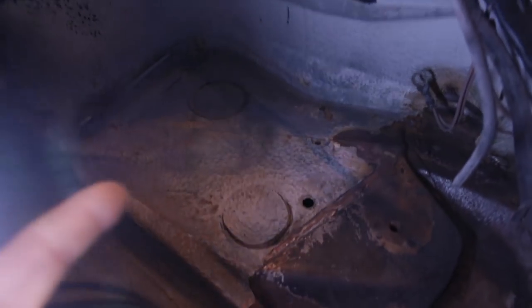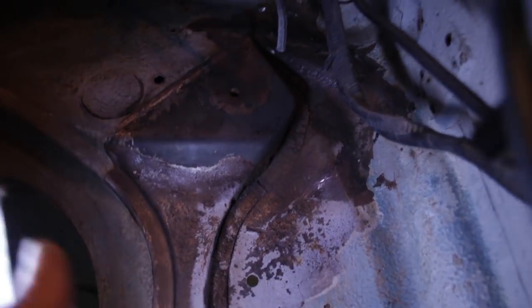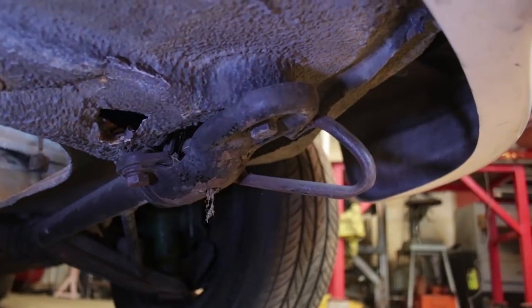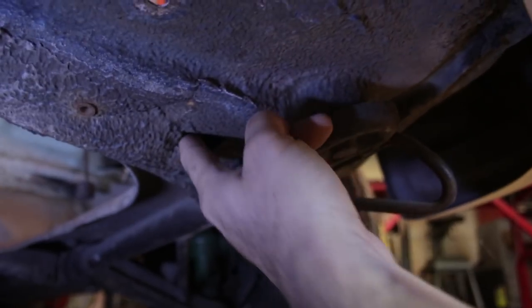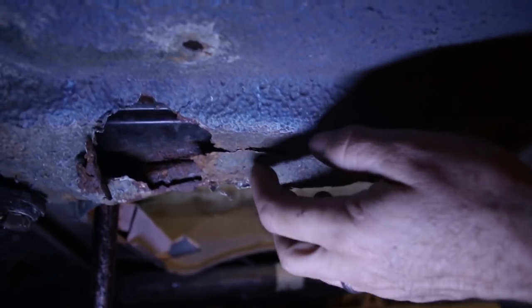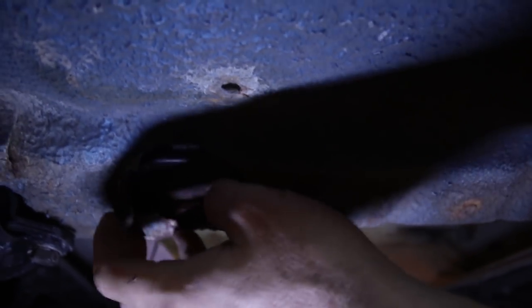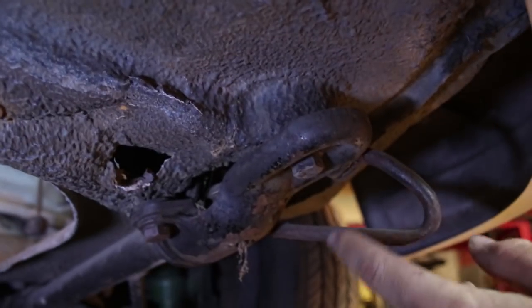At first glance it doesn't look that bad from the inside. This is the battery tray — this area right here is where the battery goes. Once the battery leaks, it all seeps into these low points in the seams and then goes underneath. Here's what it looks like from the bottom. Looking at the driver's side, just underneath the battery, there are huge holes. The corrosion can travel all the way down to the passenger side. This is where the suspension arms attach, so this is an important area of the car and needs to be repaired correctly.